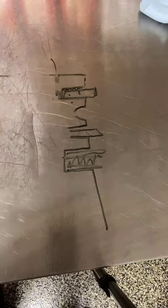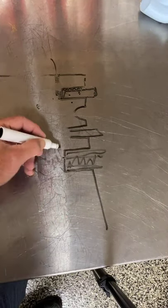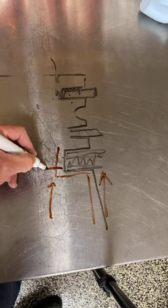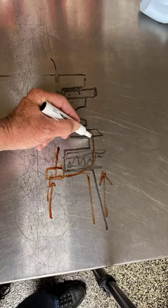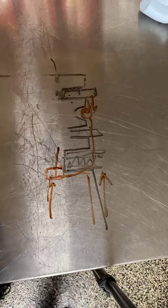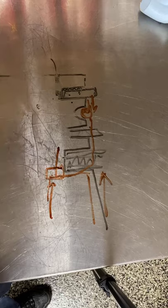My markers are running out of gas. And your vacuum comes up inside this piston. It's out here under the rings, and it's inside the piston, and there's a drain back hole in here, and you want this vacuum to pull through here, and you want it to pull by here, and you want it to come up and get vacuum, put vacuum under all of this, and pull vacuum under the bottom of this ring,